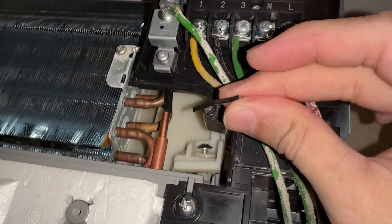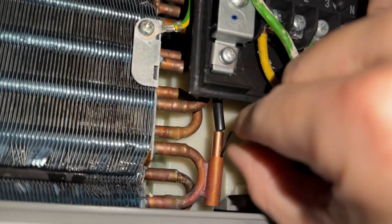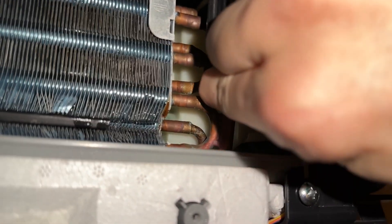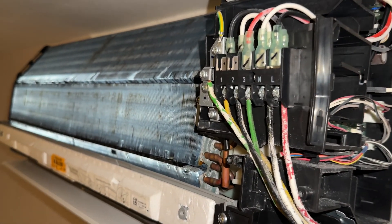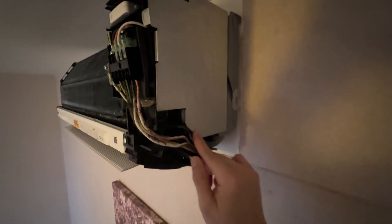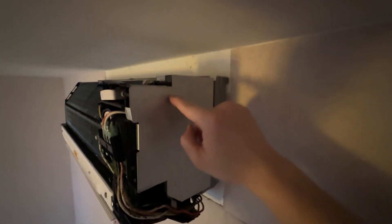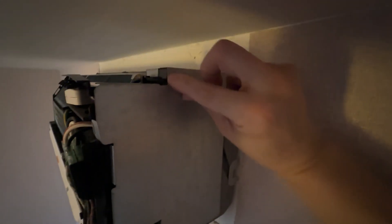Remember to slot this pin — just slot it back in. This is to make sure the thermistor is tightly in contact with this part. This is the pin where you need to make sure it's in together. I successfully replaced the thermistor. Now it's time to put back everything. Just need to put back this metal plate. It's all clipped back in — make sure this part, this part, and on top here are all clipped back in. The wire for the thermistor goes inside this small hole, so that the metal is not blocking it.